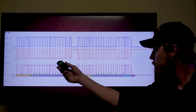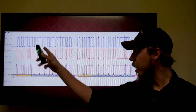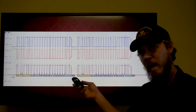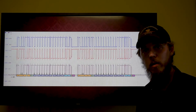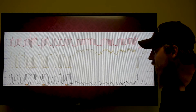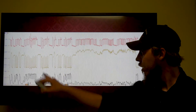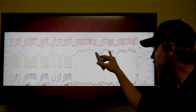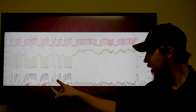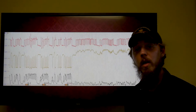The coolest concept to me is the lead into self-healing networks. Looking at standard CAN bus data packets — CAN high, CAN low, and the math channel CAN high minus CAN low — with perfect termination resistors and network traffic, everything decodes cleanly. But on a 2014 Buick Regal capture, CAN low goes all over the place; signals are bouncing around, we can't get good data packets through, and once things go high we have no communication at all.